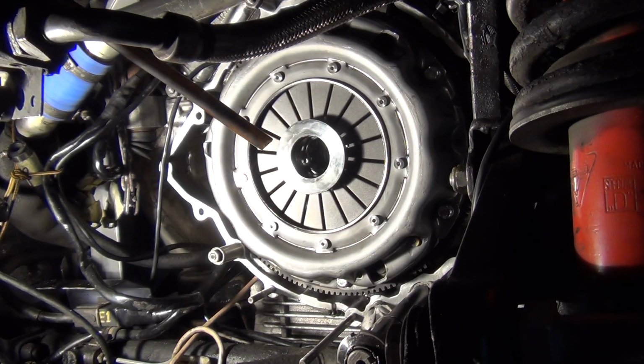I'm now going to do it to 30, and then potentially between 30 and 40 foot-pound. I do not want to snap another bolt, but these are brand new bolts now. The old ones are probably 30 years old. So I'm going to do that. I'm going to move the camera out of the way so I can get this really accurate and get back to you. So the next step will be preparing the bell housing to mate with the engine. Okay, I'll get back to you.